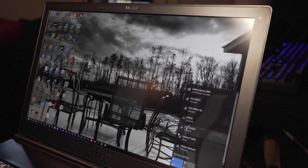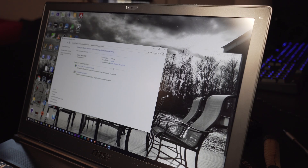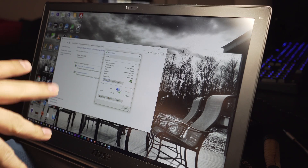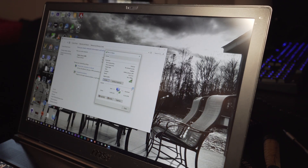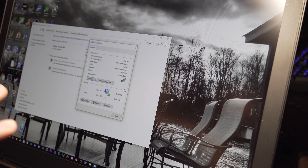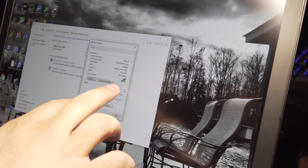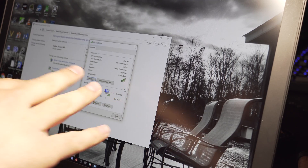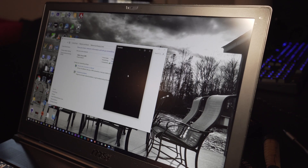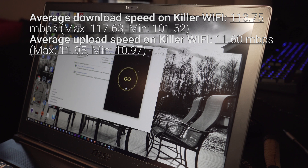I have great news — Wi-Fi works! The Wi-Fi signal quality looks about the same, but the speed changes. Before, on the Killer card, the speed would always be the same: 866 megabits per second. With the Intel card it dips down to 585, goes to 600, then 400 — it goes up and down. I'll do a few speed tests. I already did the speed test on the previous network card, so let's see the difference.